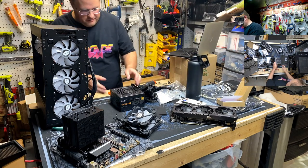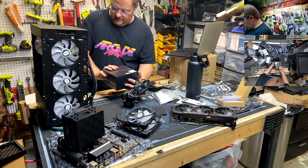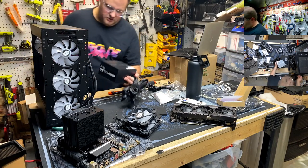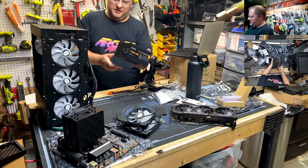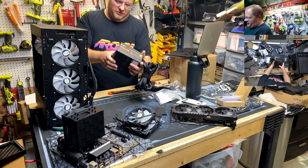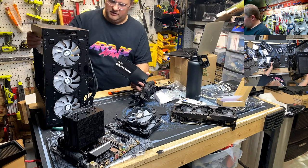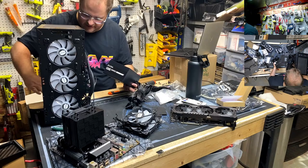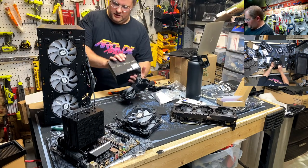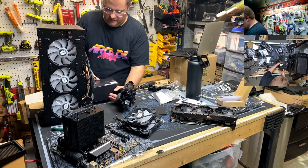Okay. Power supply. We're gonna intake. That's the perfect. Oh, we can choose. So again, PC building advice: fan can intake from the bottom. If your case is sitting on carpet, don't do that. Or in this case, there's also perforations into the motherboard area, so you can flip it over. But I think we're going to intake from the bottom because it's not going to sit on carpet.